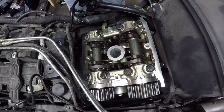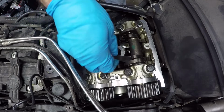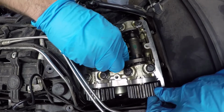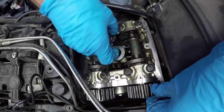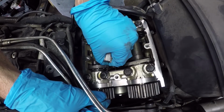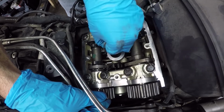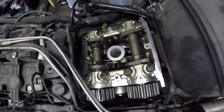I'm just going to start off with the lower end of the specification to see if it'll slip in. So we'll start here with this opener. That works, so that opener's okay. That fits, so that opener's okay. A little bit of drag on that, so that opener's okay. And that one just won't fit, so we know that opener is too tight there on the exhaust side on the upper cylinder head.